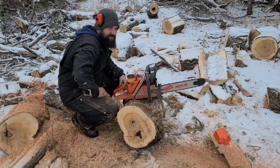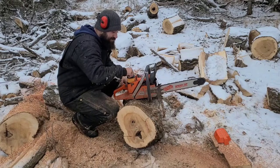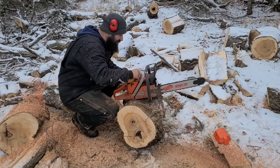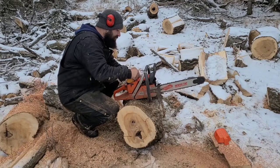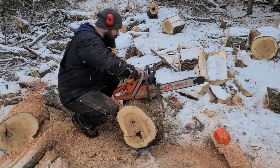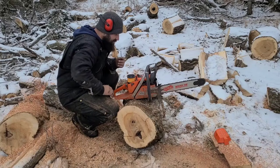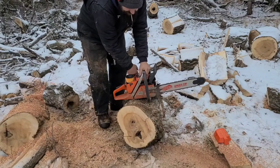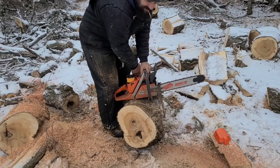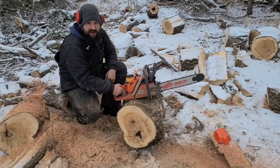It's one of those things. Then when you get good at those things and you port your saw, then your saw will rip. But every saw is going to tune different and in different circumstances. Interesting. Just making sure my spark plug's tight, a little sooty around there. Okay, I put it back out to a 1 1/4. Let's see if this thing starts. You want your saw to restart. Check the RPM.